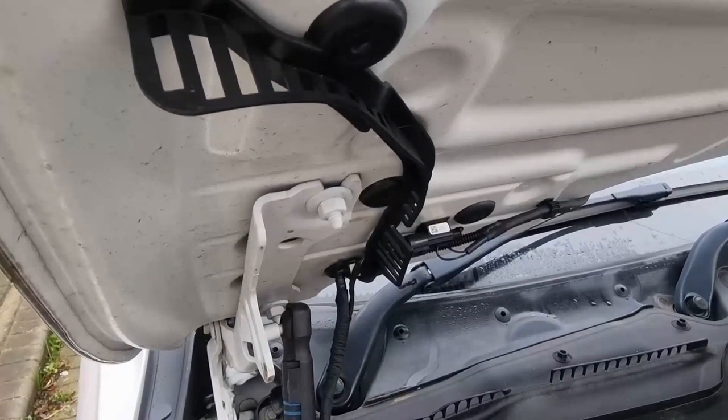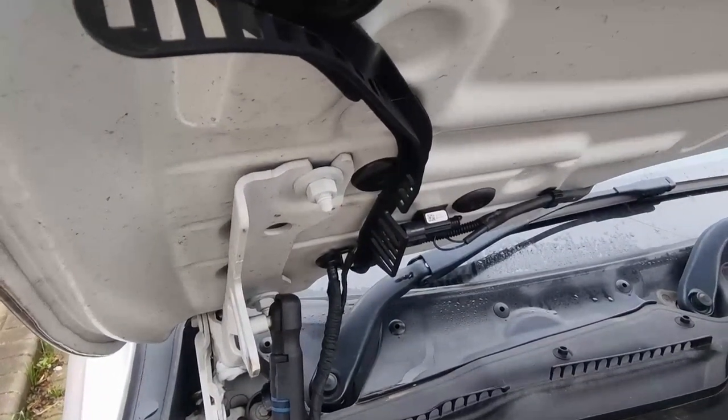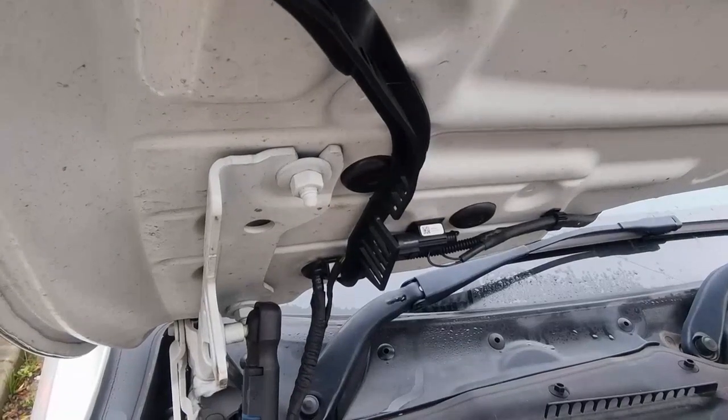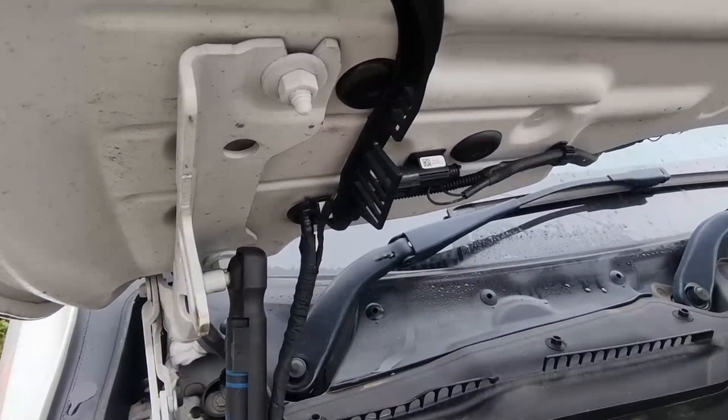So what I'm going to do, I'll show you two things today. One is an emergency quick fix which is just opening up the bonnet, blowing back down the pipes, trying to blow the gunk off the two filters, which will momentarily fix it to get you home. But eventually all you're going to be doing is sucking the gunk back up into those filters from the bottom of the reservoir. The second is how we get to the reservoir, take it out, and clean it.